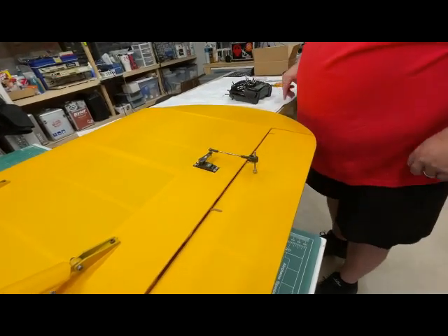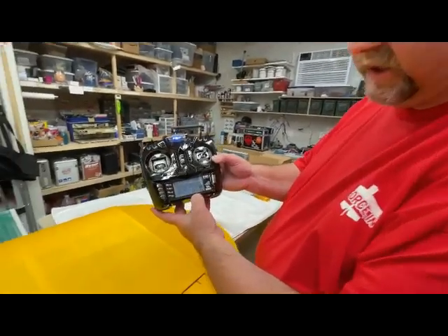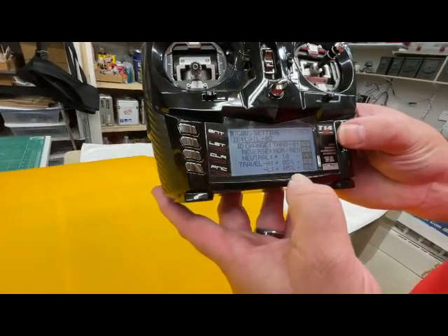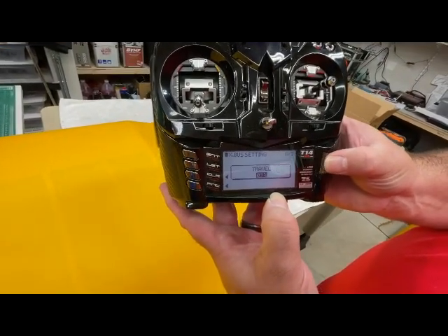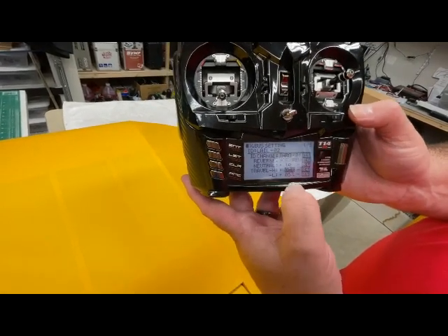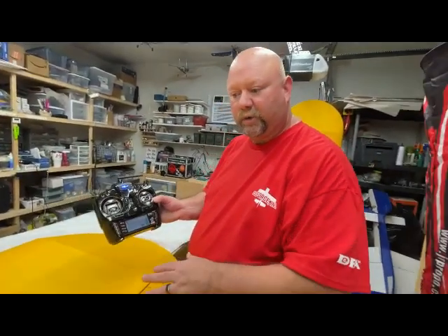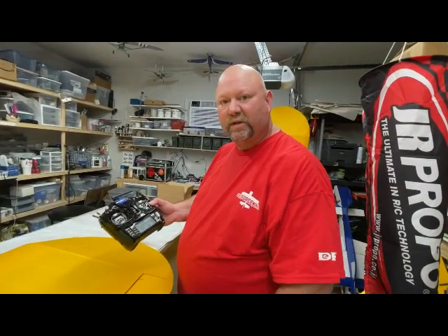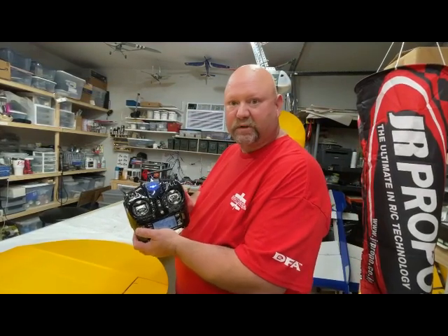Now we've got our center set, endpoint set, endpoint set — looks great. We'll put a nut on this and if we need to, we can go back into the radio. One thing to show you: this five percent is where we are now, but we can actually change that down to one percent and up to ten percent, so we can fine-tune it as fine as we need to. Once the nuts are on, we'll do a little fine-tuning to get rid of the slight hum we hear when they're loaded. Thank you for watching.